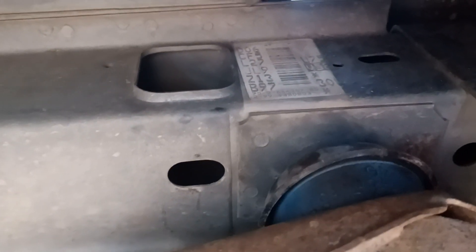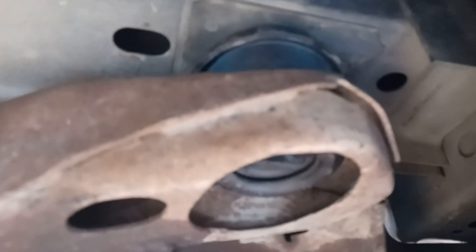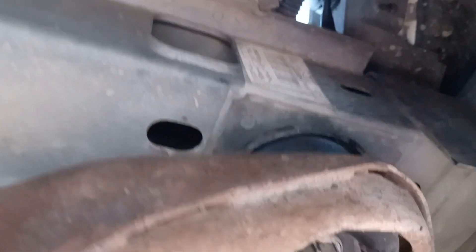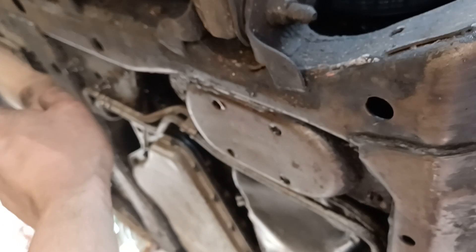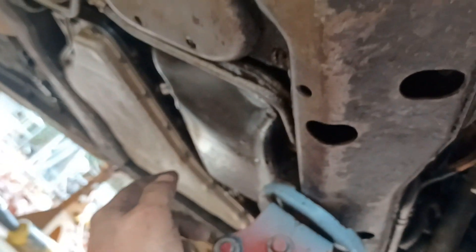Now that I've got that other one done, we're going to jack up on our handle here and watch it go up — get it flush. Now that we've got that done, we'll stick our bolt in here and tighten it down, and that's it, that's all you do. I didn't have to replace any of the bottom ones on mine. I've got my jack on the front cross member. It helps if you have this on a flat surface.